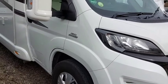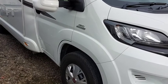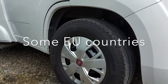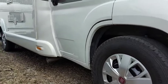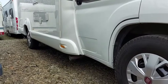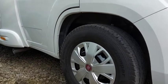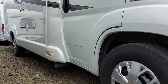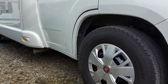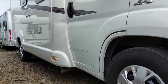If you're hoping to go to Europe in your motorhome and you're hoping to cover the winter months, a lot of countries either require snow chains or require you to change your tyres. They would need to be mud and snow tyres, or have a specific winter use symbol on the side. Please bear that in mind if you're buying new tyres. If you're just in the UK you'll be fine with standard tyres, but if you want to go to Europe in the winter, check the RAC or AA site for the information you need. Don't waste your money on summer tyres — get the right tyres for how you're going to use your vehicle.